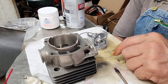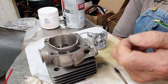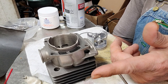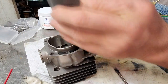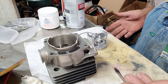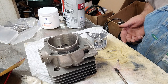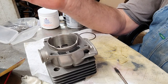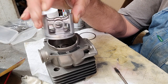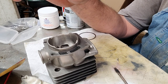You'll notice the piston feels a little tighter than before because the crosshatch leaves little micro burrs. If you're close to tolerance, you can knock those burrs down with your 600 grit - just go in there by hand and roll it around. Wash it well with soap and water many times, make sure it's absolutely clean. It's got to pass the drop test. Don't even bother working on your ring gap until you have your cylinder and piston fitment correct - it can't slow up anywhere, it's got to drop smoothly.